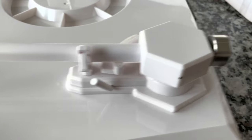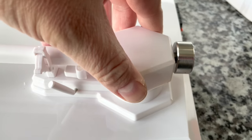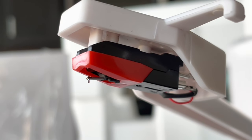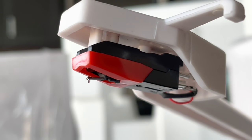We've got a cueing lever and the descent is very slow. The little lift shelf even has rubber on it, coming off a little bit there. Looking at the gimbal — that is a little loose for sure. Will it matter on an entry-level unit? Hard to say. For the cartridge, we do have the Chuo Denshi clone. Look at that little spur at the tip of the cantilever — very interesting. It does have a metal cantilever and a bridge, so it is the higher-end variant stylus, which is good. I'm assuming this is probably a sapphire tip, maybe a diamond tip.